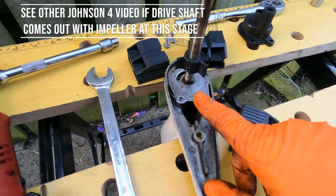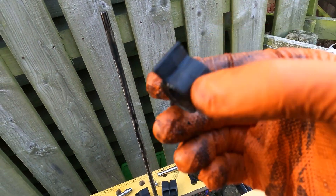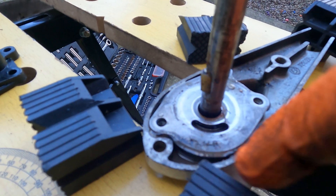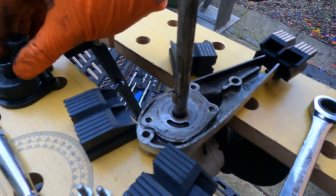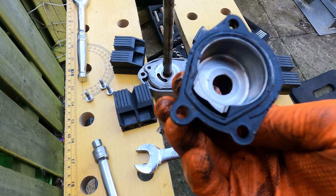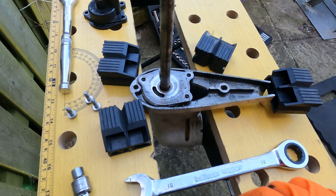I've taken the top cover off and I've just started the impeller — let's get it off. There we go, that's the impeller — just a triple blade. Looks to be in quite good condition. It's held captive on the drive shaft via that keyway — it's like a plastic insert. We'll also be changing the bottom wear plate because that's what the impeller runs on. In the cover we also have the top cover wear plate, which is in good condition with no major wear or grooves forming. The bottom one likewise looks pretty good, but I've got a new one so we'll change that and the impeller.